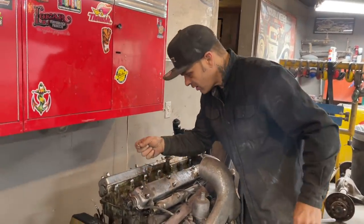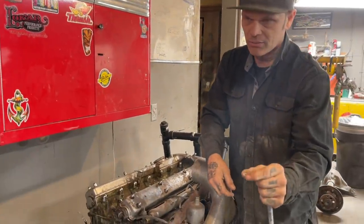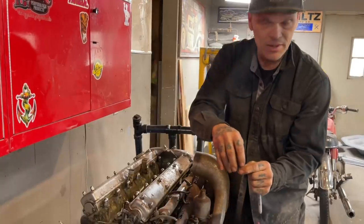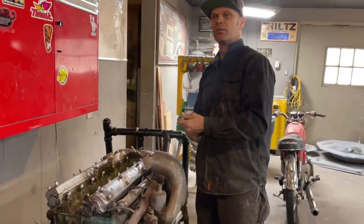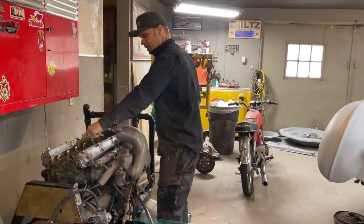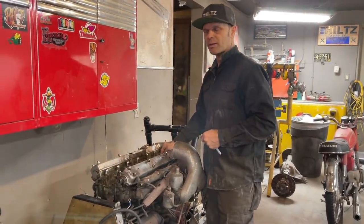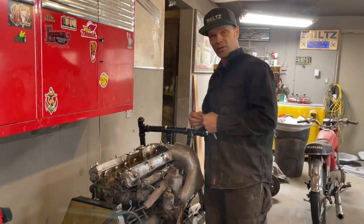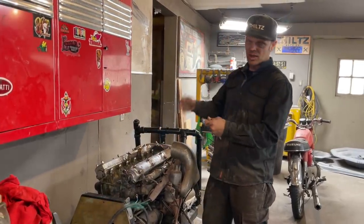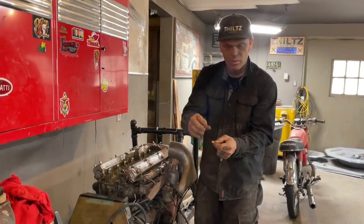The right thing to do is what I found on the end one, because we got it quite quick. As soon as I got that puddle on that spark plug, throw a washer right down quick — lock washer or flat washer — and weld that really quick and get a puddle on top of that while it's red. Then throw the nut right down quickly on top of that and try to weld that nut in the middle on top of that washer. Let it cool, do your wax, do your penetrant, do whatever you want, and then try to take it out. With the first and second ones I was welding the spark plug, got it all nice and red and hot, then waited a minute and fuddled around, then tried a nut on top and it twisted off. What I should have been doing is getting that spark plug red hot, throwing the washer down while it's red hot, and keep going — put a puddle on top of that, throw your nut down, keep going, then let it cool and try it.